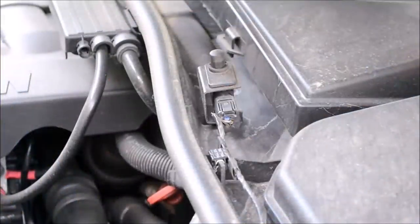An important step before getting the engine bay wet is to waterproof all the wired connections using a plastic bag and detailer's tape to avoid any potential damage to the electrics. Use your eyes, find all the plugs and cover them up. You just need to remember not to get too close to these particular areas when pressure washing.